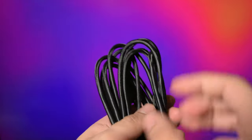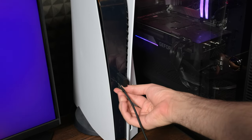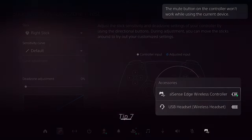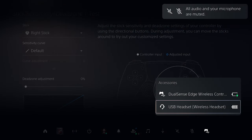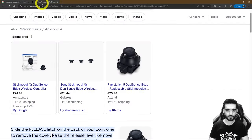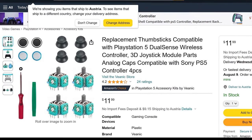Another tip is you don't have to use the official cable. You can also get a USB-C to USB-C cable and connect it to the front port, and it works fine with no issues. If you're wondering about the input delay, it's the same as back ports. And you can also put any standard cable in the locker module and connect it to the controller. Keep in mind the mute button on the controller can't mute the Pulse 3D microphone, but holding it can mute all input and output devices. Replacement for an analog stick costs around $30 where I live, but you can buy it from Sony for $20, while you can replace a normal DualSense stick for something like $10 at repair centers. So if you want this controller only because of the stick replacement, it might not be the cheapest option, but it's definitely the easiest way.